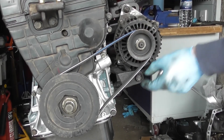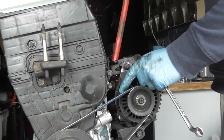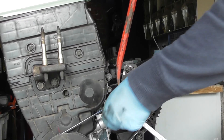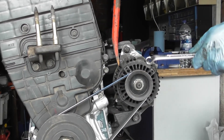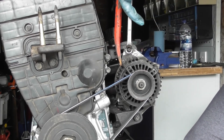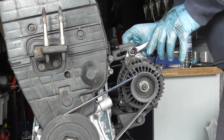Make sure there's a little bit of tension on the bottom bolt and not too much to stop it. I'm going to use Jimmy to tighten up and put tension on this belt — just whack Jimmy down the side here. You see how that's adding tension to the belt? Not too much, but just enough. Make sure you can do half a twist. Get the tension on there, get your 12mm and tighten that up. Take Jimmy out and you should see that's nice and tight.